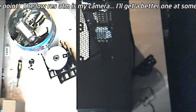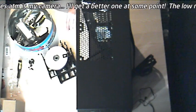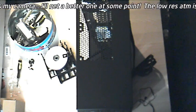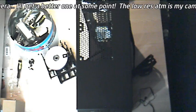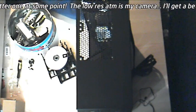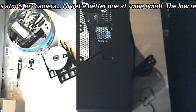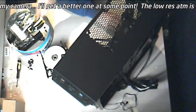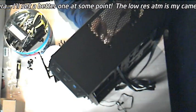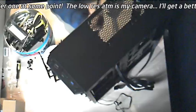I'm just going to put that over there, because I've got my thermal compound and all that in it, which I will need in a few, but I don't need right off the bat. Okay, one thing I will note whilst I'm building this, I am short of one GPU. I'm waiting for that to arrive, but I do have the first of two. I had 4 GPUs in here, that would look so baller, but I only have 2 GPUs at the minute. One of them being dead, but that's the one that's getting replaced. So I'll be doing a base configuration using the dead card in this machine just to get the basic cable management. So I'm going to use two 8-pin connectors and just basically run those in the most tidy way possible to get them to look really pretty.